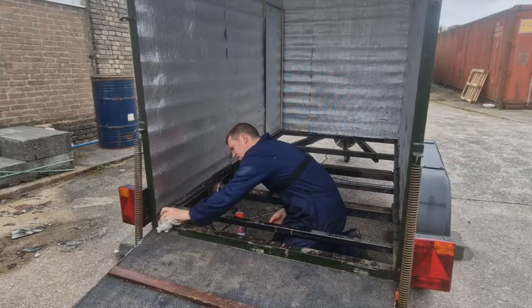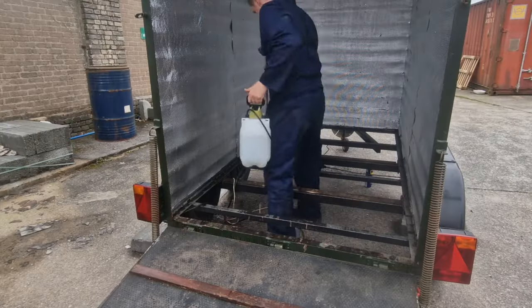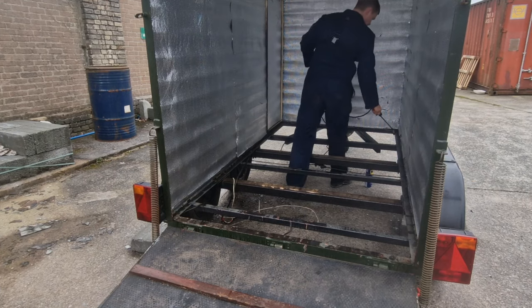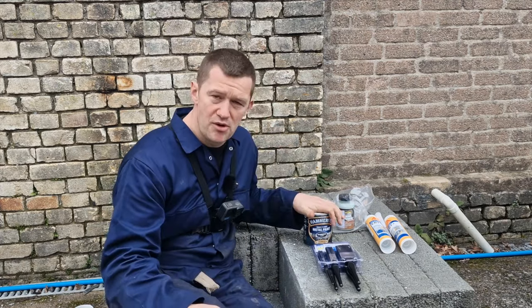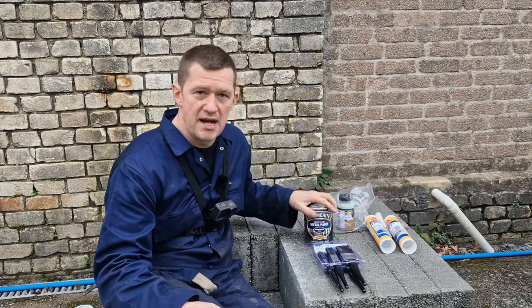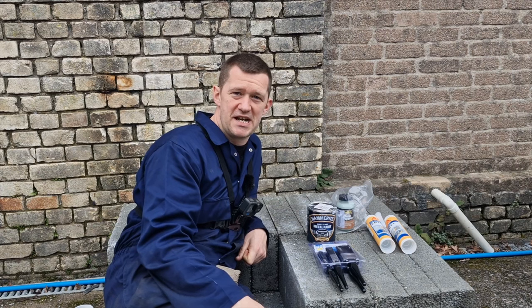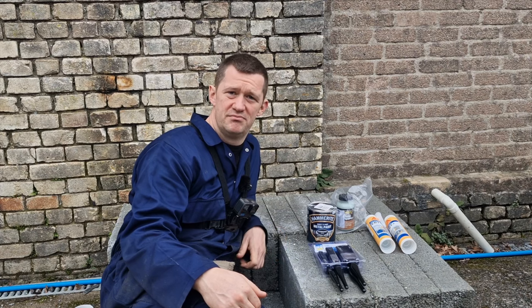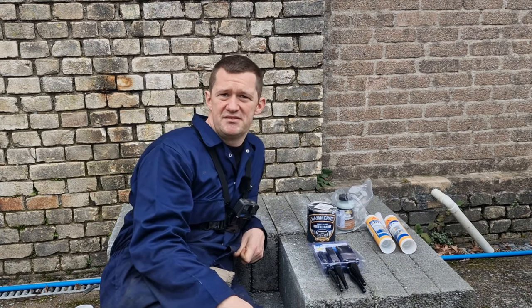So we've cleaned the chassis with WD-40 to get rid of any of the real heavy grease and dirt. We then used heavy duty degreaser, which I've sprayed onto the frame — I'll let that soak for a bit and then that'll be rinsed off. Then we'll have to allow it to dry before we can put the rust converter on. Once the rust converter has been on, we need to allow that to dry, then we'll Hammerite everything and then we'll be ready for the floor to go down. The floor is going to go down in the next episode — each of these steps is going to take some time to dry and we just haven't got the time today. So subscribe, like, tell all your friends, your pets, show it to everyone — but we'll catch you soon.